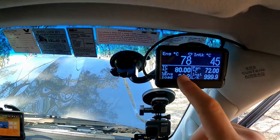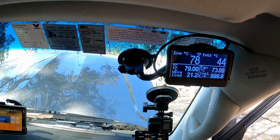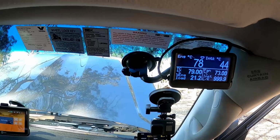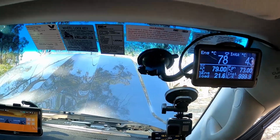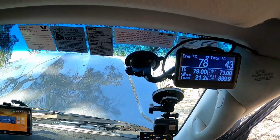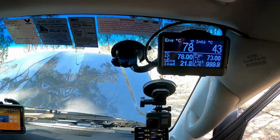So that temp, when you are accelerating, anyone that's got a 200 or whatever and doesn't have anything to monitor temps with, that's an interesting one, and I would say definitely get something, because the temps range massively. And again, there are loads of videos out there that show the difference of these temps when you're accelerating and the torque converter's unlocked, let's say, and the temps are skyrocketing compared to when it's locked up.